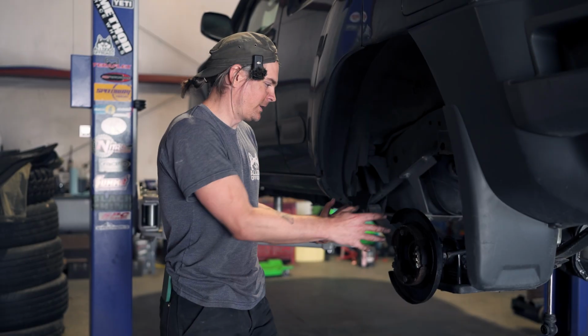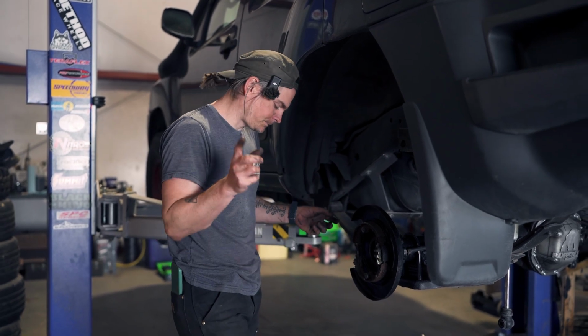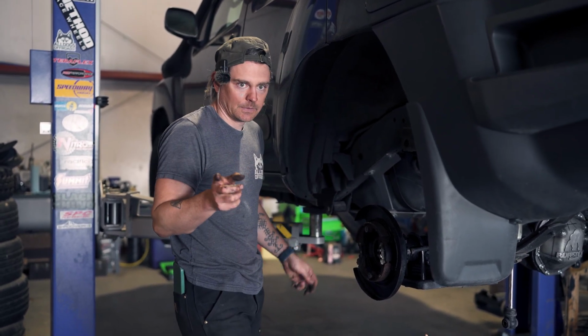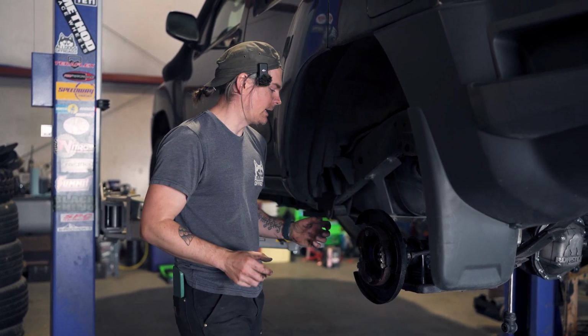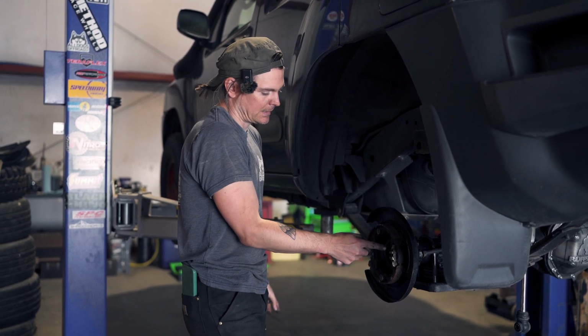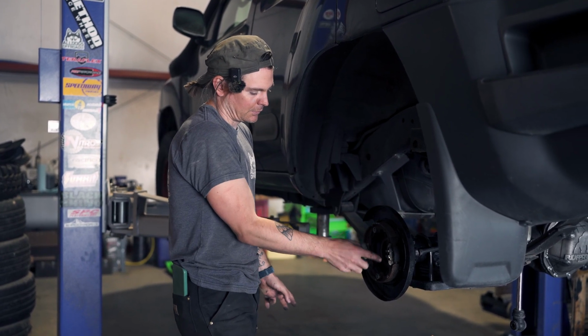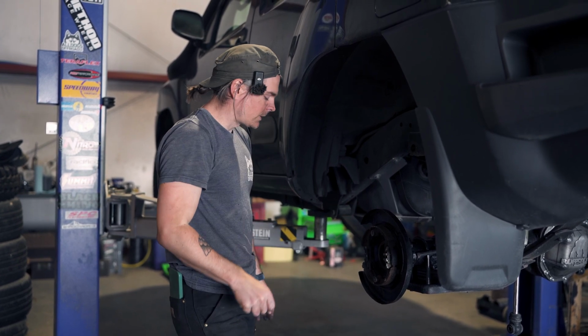We got the backing plate put back into place. It's not bolted in. The axle shaft has the retainer on it with 4 bolts that will clamp everything together. So it's sitting kind of loose right now. But I've got the e-brake cable put through, and the e-brake drum shoes. That's all set up and good to go.